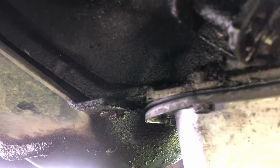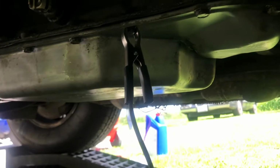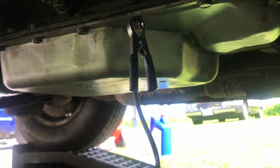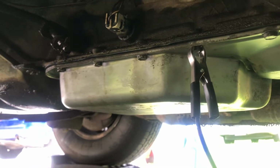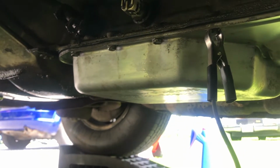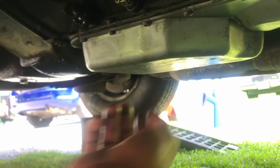So, with it coupled to a 200 transmission, it's not really geared for power. It's more of a dog that just burns a little bit of oil. But anyway, fuel economy would be great. Instead of racing the engine in fourth gear, you can control the RPMs with your foot, and that's no darn good either. So it'd be nice to have it lock up in fourth gear. So that's basically all there is to that.